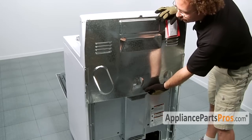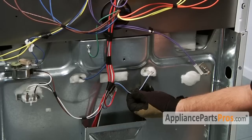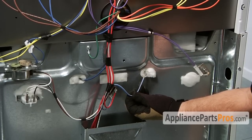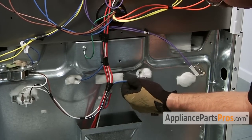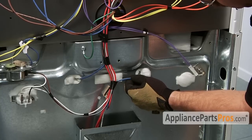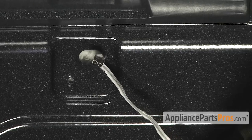Once you have the screws out, go ahead and lift the panel off. Here's the wire that came back out through the hole in the back of the oven, so you need to find a clear path through the insulation into the back, back through the hole in the oven, and then have somebody put a twist tie around it to hold it in place like the other side.